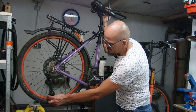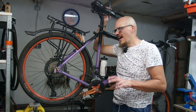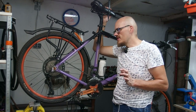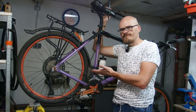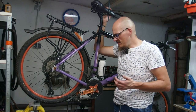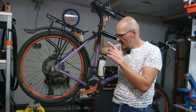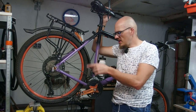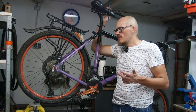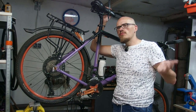Of course, you would need a derailleur with a clutch because this thing has problems with cassette inertia, let me say it like this. It's kind of annoying if you're riding aggressively. However, it's working. Now I'm only torn between whether I should retain this setup, go full 1x12, or return to the original setup, which was 11-32 10 speed plus an SLX derailleur with a clutch. But that's a problem with my brain, obviously. Anyhow, I hope you're entertained, and I hope to see you in the next video.